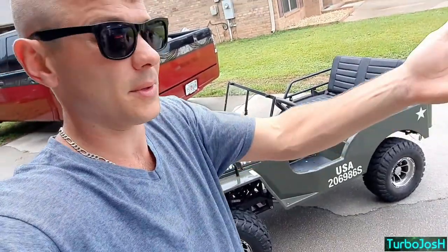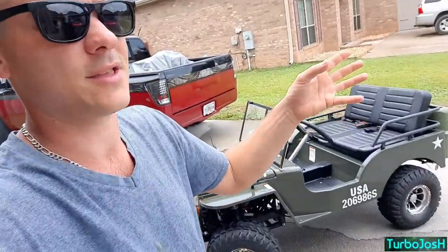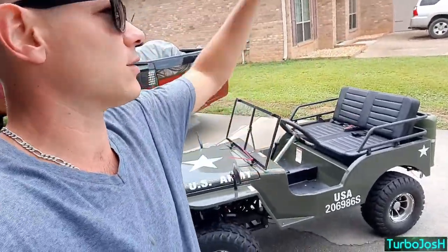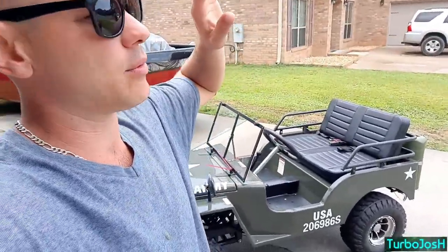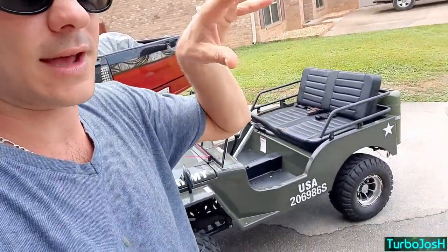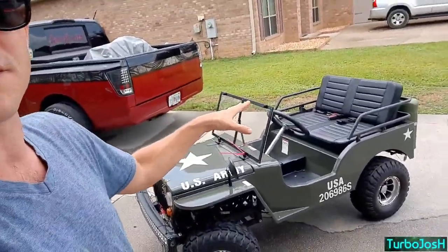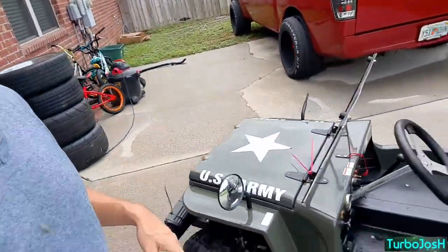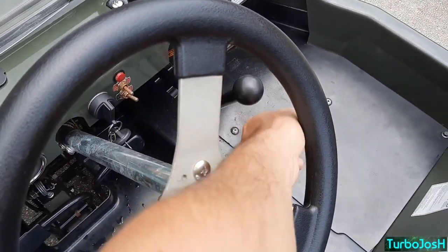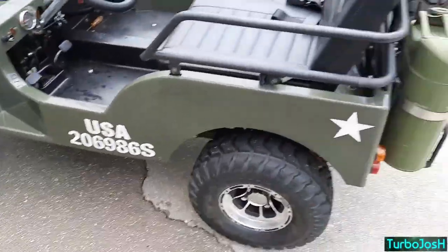You can't pull a car — well, you probably could pull a car with the car in neutral — but you can only pull so much before you start slipping the clutch on the Meerkat. Its capabilities to me were mind-blowing. I took it down the road to the gas station, pulled stuff around the yard, cut up logs. Any weight around the yard that you'd use a riding lawn mower for, the Meerkat would handle no problem. So does this — I like this because it's a 125cc and also a semi-auto three-speed, which means it doesn't have a clutch lever. You just pop it downward to go to second and third, and pop it up to downshift to neutral. You can literally pull anything with it.